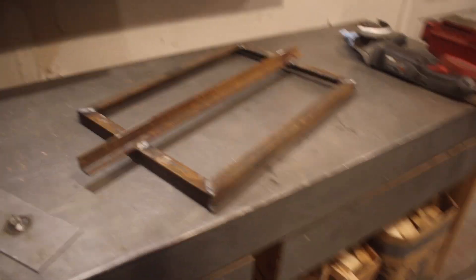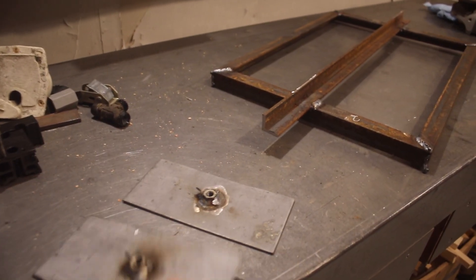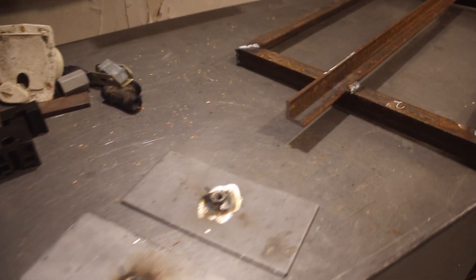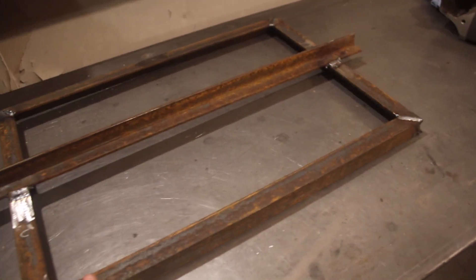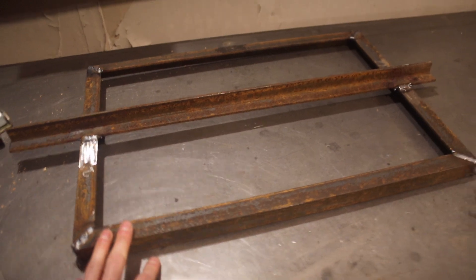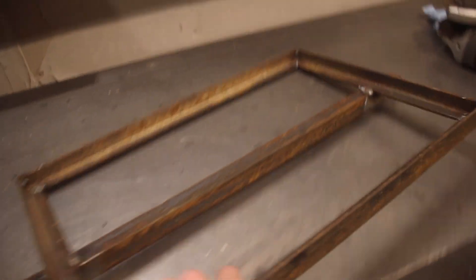Making progress — thanks to my friend, we got some nice welded-up parts here. We call them the base plates. They're going to go underneath with welded 3/8 nuts on there for the threaded rod. This is the battery hold-down made out of one-inch angle iron, and I've got to grind down all of the welds, especially in the area where it's going to be against the battery cases.